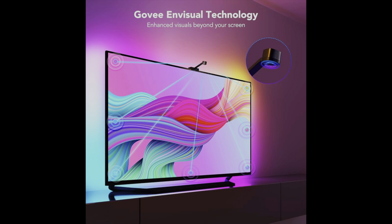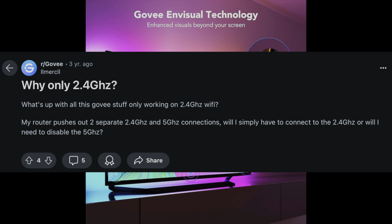Now, the Govee app I was forced to use didn't even work with its own lights on a Wi-Fi 5 GHz bandwidth, so I had to go into my wireless router login and split my bandwidth into two separate output signals. One for all my devices at 5 GHz and one single bandwidth just for the Govee app to work at 2.4 GHz. And I had to disconnect and reconnect my iPhone between 5 GHz and 2.4 GHz connections whenever I wanted to use my TV.